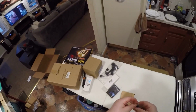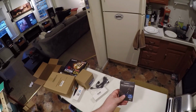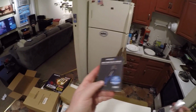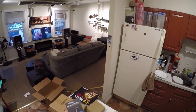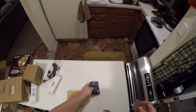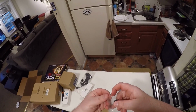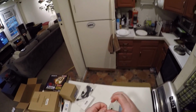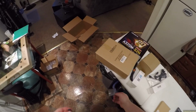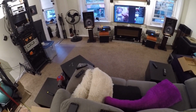It loads it into RAM, or into the cache, which is the M2 drive, and this will be the cache for the entire system. So when I'm taking things on and off the network, it caches them on this, which is only a 256. I could have gotten a bigger one, but I'm using it for storage. If I'm moving 100 gigs of data, that's still only half of what this is, so it can cache it and then slowly move it into the drives. I've also been told that because there are no longer limitations on size, when I get a 10 terabyte drive, it's going to be 10 terabytes.